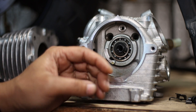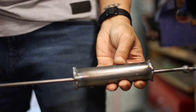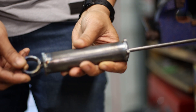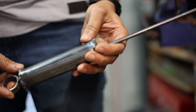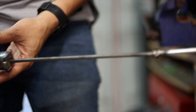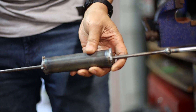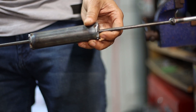What I need is a slide hammer to be able to pull this out, and this is the solution I came up with. What I ended up doing is I got a rod and a piece of pipe, put two pieces of metal on the end with holes, put a part for the end, welded it all together pretty decently, and then welded the bolt onto the end right here so that I could thread it in and then pull out the part that I need. I didn't want to buy one of these, so I just ended up making one instead — just make it if you can.